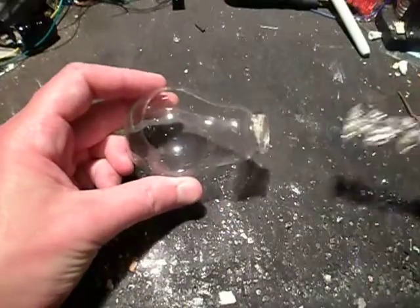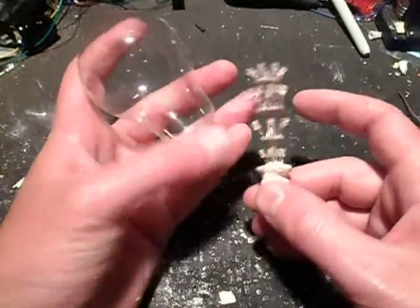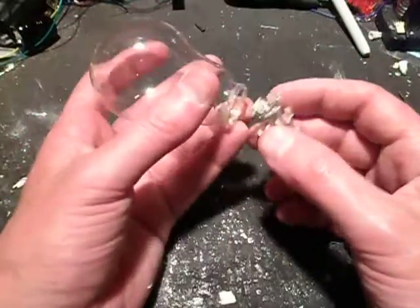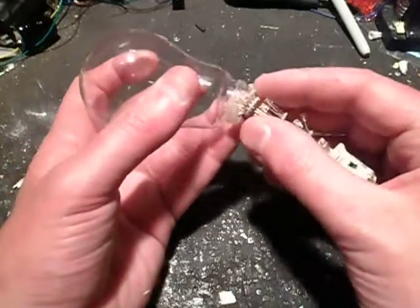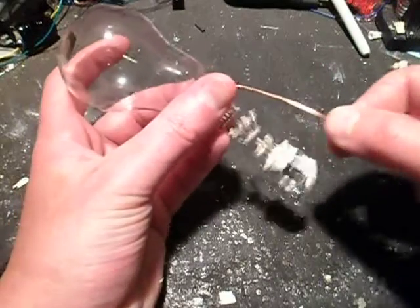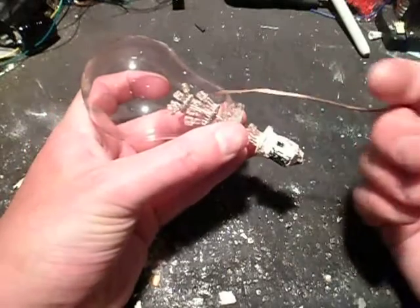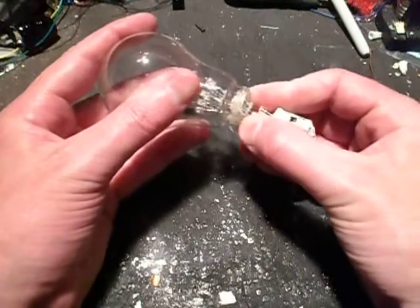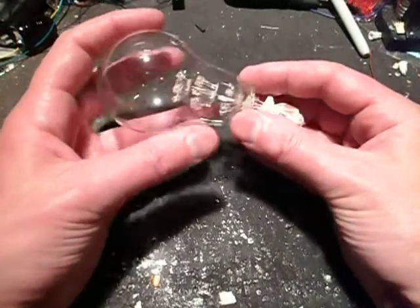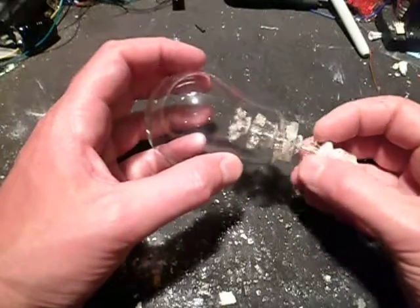I've squished the LEDs up in here because I've already had this out. This is a glass globe, and it's very clear that the LEDs in this lamp are, I would guess, put in manually — because I couldn't think of a way a machine could do this. It takes quite a lot of force to put these LEDs into position, and I'm guessing they're fed in, initially all lined up straight, and then a tool like this is used to hook each layer of LEDs down inside to an appropriate position. I discovered that when you got to the second layer, if you just pulled them down to a right angle, and then once they were all fanned out at a right angle, you pulled them down again into the base. It set them all at the exact same angle by aligning them all up in the glass lamp itself, and they were pretty much the same angle as in the lamp when I bought it. This may just be a very labour-intensive lamp, done ship-in-a-bottle style.